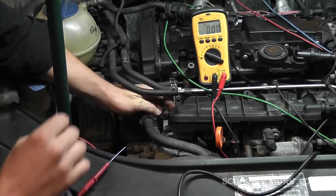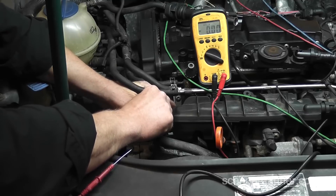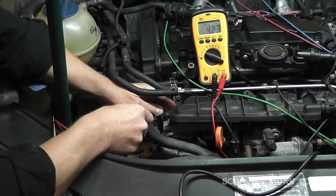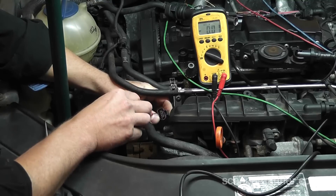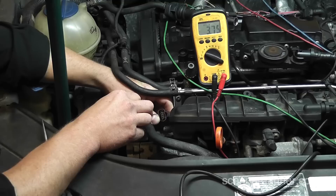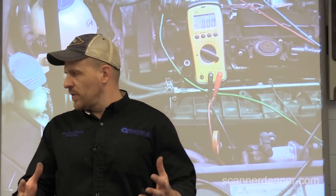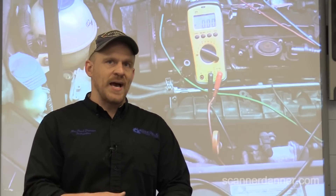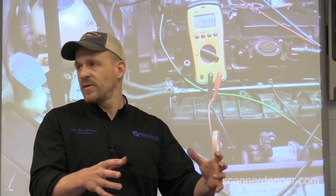We have bad grounds across the board on our sensors — I measured the coolant sensor, the fuel rail pressure sensor, and the cam. Why do we still have a crank signal with a bad ground? Because a VRS creates its own voltage — it doesn't need a reference. So the rest of these sensors are all dead, and that's probably why the computer isn't talking to us either. Rather than going through the harness trying to find a bad ground on each leg, it makes more sense to measure the sensor ground wire at the computer next. If it's good at the computer, I have an external harness issue. If it's bad at the computer, then we have a bad computer external ground.